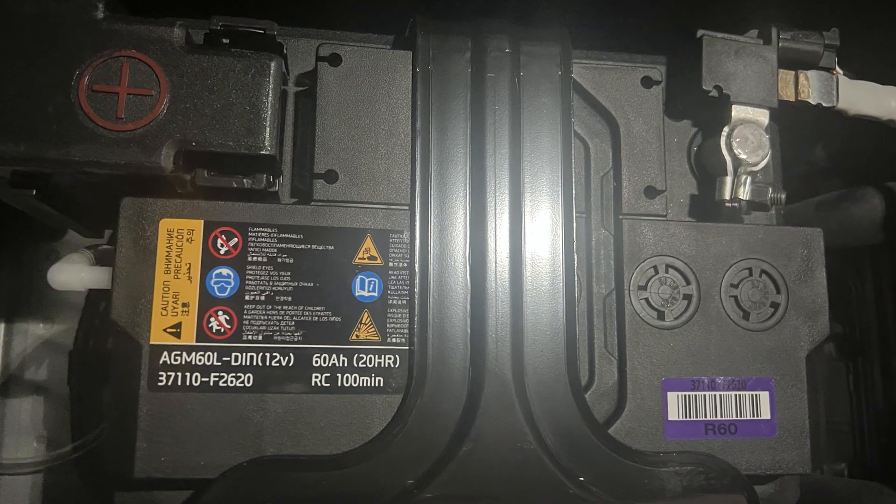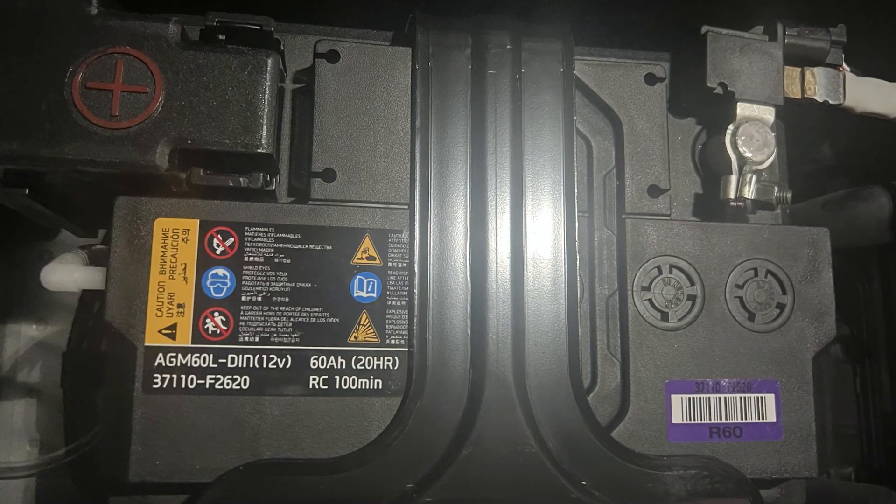The problem has two major culprits in Kia and Hyundai vehicles. First is a problem with the 12-volt battery voltage. When it drops, the electronic control modules and some electric units may not be working properly, which leads to various codes including ABS codes stored in control modules. These are often just glitches, easily fixed by charging or replacing the 12-volt battery.